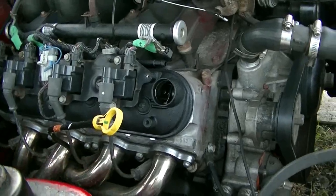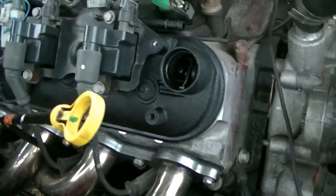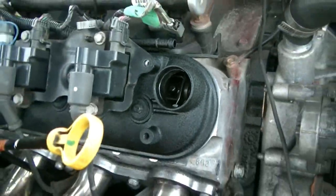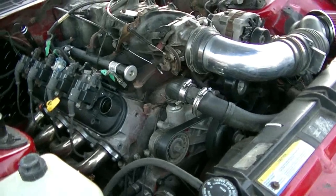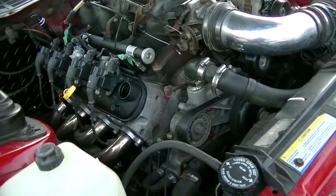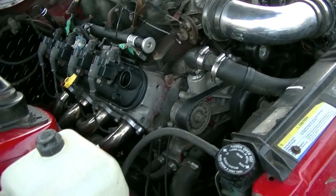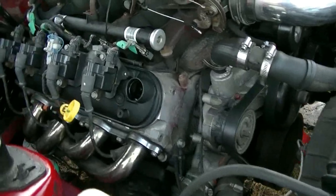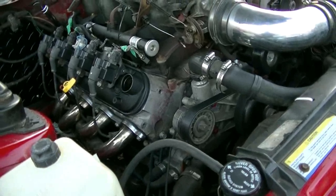I'm pretty happy after changing the oil, getting it up to temperature, and flushing it. I can see oil shooting from the rockers, from the push rods now, so that makes me happy. And I think I figured out the misfire is the crank sensor relearn, and I fixed the exhaust leak. This is actually good news for once, I think.